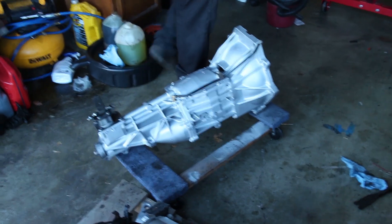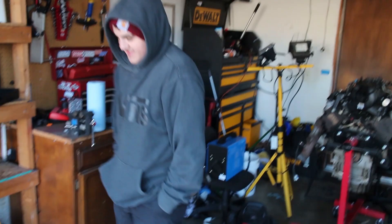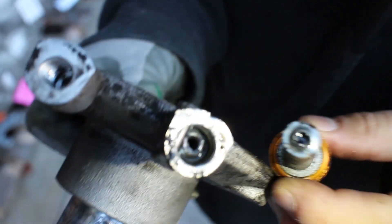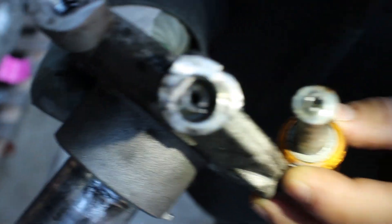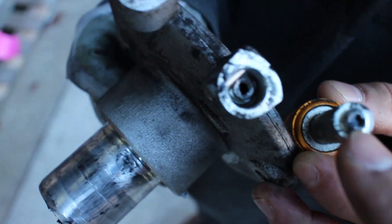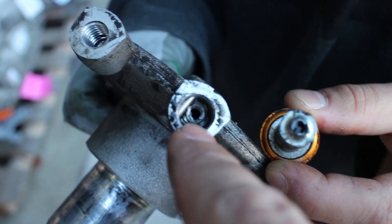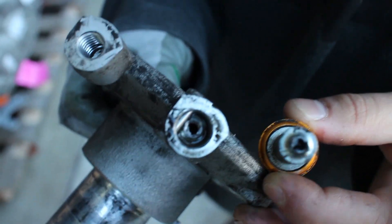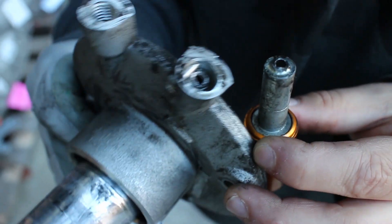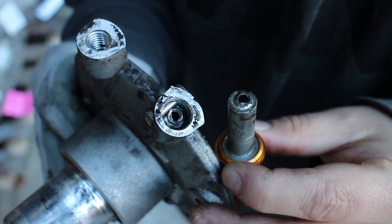Tristan's going to get started taking out the throwout bearing so we can get the clutch line input thing back in. We got the bearing retainer out, and it looks like we actually broke this off — it just sheared right off from there, and you can kind of see the other part in there. Turns out we probably do need to do one of these, because it kind of sets us back. We can't exactly get this really fitted on until this gets fixed.